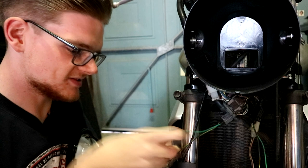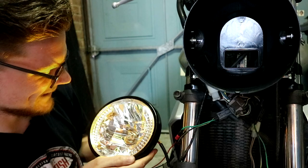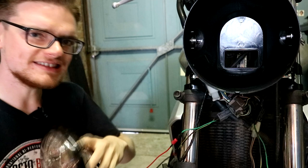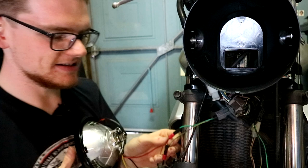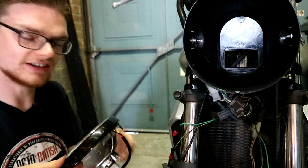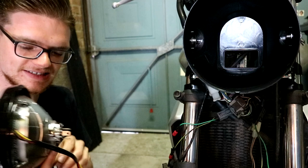The right-hand indicator works with a little LED strip — that looks freaking awesome, so good. Now the reason we're not plugging in the yellow wire for either indicator is because this is actually a bit too modern for the Kawasaki. What the yellow wire on these actually does is designed for if your bike triggers the indicators under hard braking — an immediate example is the new Honda Fireblade. If you brake really hard, like a lot of cars are starting to do, it triggers the hazards to warn someone that you're stopping in an emergency. We don't need that on the Kawasaki, so we're going to take the yellow wire off and cover what's left of it. Farewell — you are no longer needed.